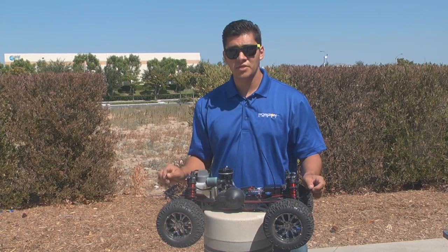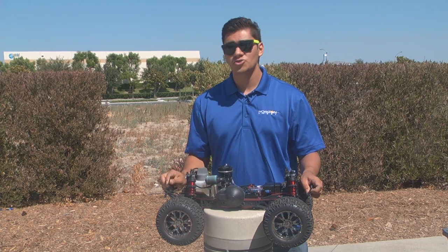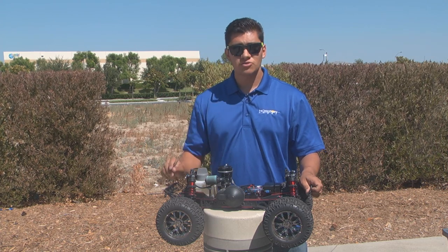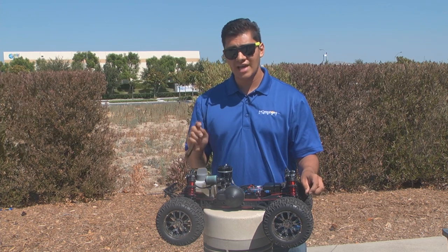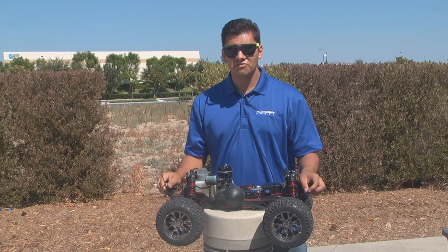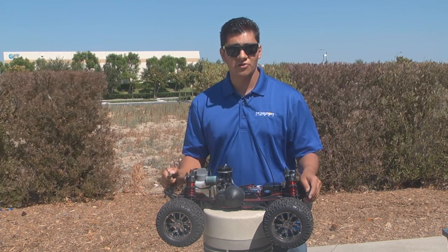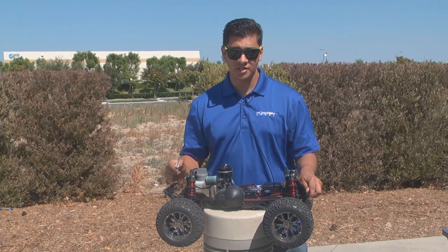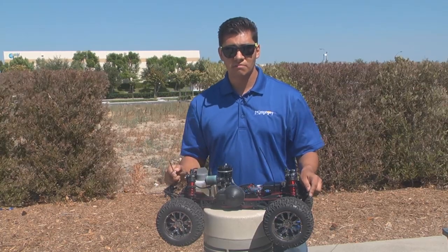As you can see, when I reach in on the bottom needle, the idle drops. So if you start your break-in process and the idle on your truck changes, it might just be because of climate or elevation. If you hear the idle is too high, go ahead and back off on that needle. If your truck is having a hard time staying on, lean out the needle in order to raise the idle. One easy way to tell if your idle is set right — pay attention to your tires if the truck is elevated off the ground. If your tires are spinning, it's a sign your idle is too high because your clutch is engaging. Back off the needle and you'll see your tires stop, and that's how you know you have a good bottom needle setting.